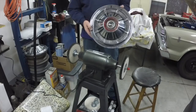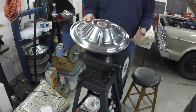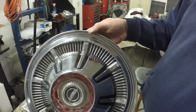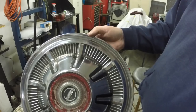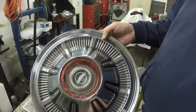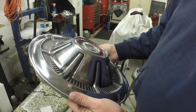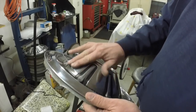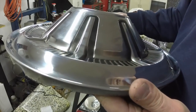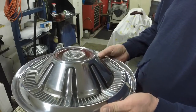In this video I'm working on this hubcap — just one off the rear. It had one big mallet dent in the rim and I just kind of bumped it out without sanding or filing it, so you can just barely see it. Filing and sanding makes the material look like a different sheen and I don't like it. I hit this with the gray compound wheel, now I'm hitting it with the green compound wheel and it's shining up like glass. It's amazing how just going from one wheel to the other makes such a big difference.